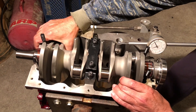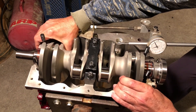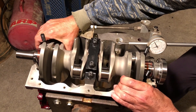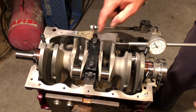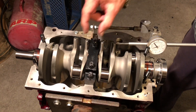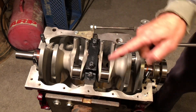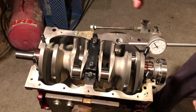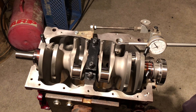We finally have what I consider a pretty good three thousandths just by moving it by hand. I'd say with our assembly lube in there, we're somewhere between three and four thousandths on our end float. You have to be real careful with any kind of cap replacement - it's tough to get that thrust surface perfectly aligned all the way around, half on the block, half on the cap. But we've got it working. We're going to continue putting the bearing caps in and get everything dialed in as we assemble the bottom end.